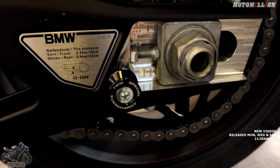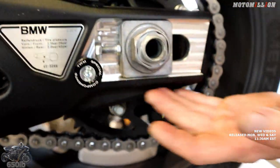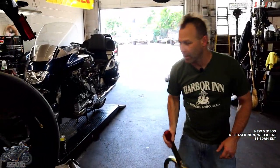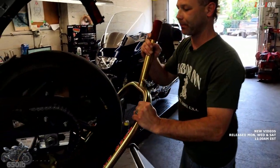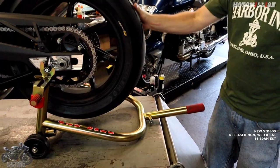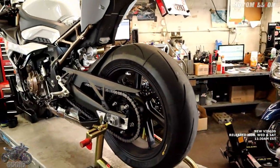While we were gone I also popped on these TWM swing arm spools, which is kind of important on this bike because if you look here there's a weird angle. If you pick up this bike with pads on your rear stand you've got to be careful - it wants to slide off and it actually can slide all the way off. So we got them on to make it easier to work with the pitbull stand - super easy, nice and stable, great combination.